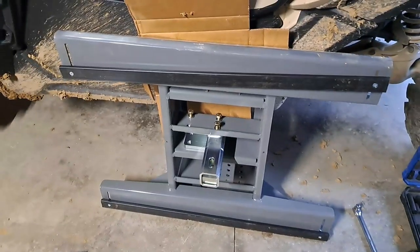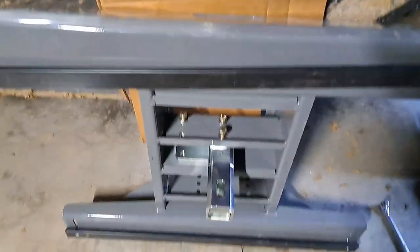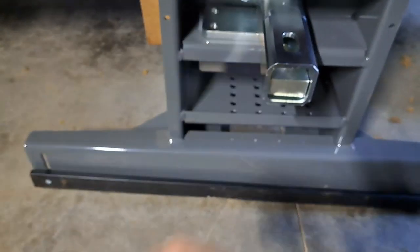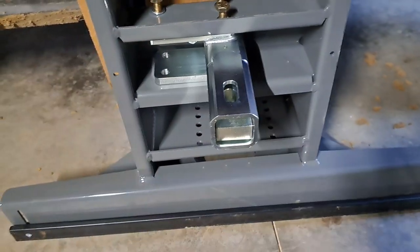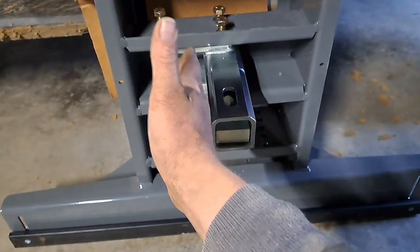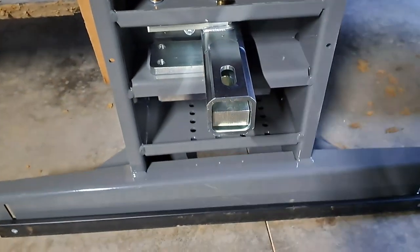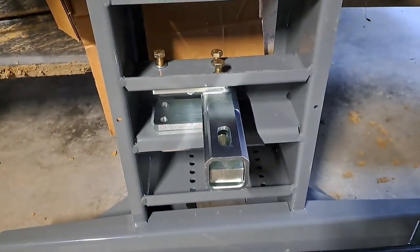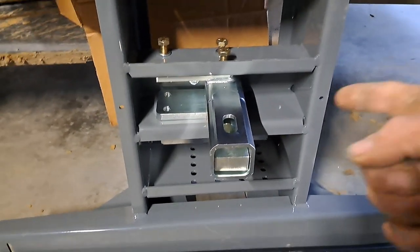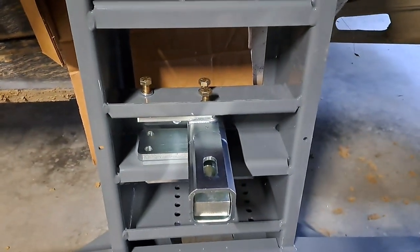And back up here, as you can see, that hitch is in the center of the fifth wheel hitch thing. And as you can see, if you were to turn this part around, it will move the hitch towards the front. This side is the front, the bolts are toward the front, toward the cab of your truck when it's installed. So if you need to, you flip this thing around, which will move the whole fifth wheel thing farther back, if you needed the clearance between your truck and the fifth wheel to be able to turn. So yeah, I'm going to get those 4 bolts in, and then we're going to switch to the side rails there and get those done.